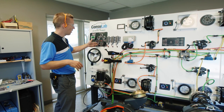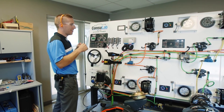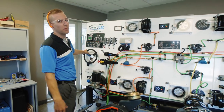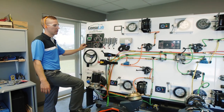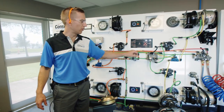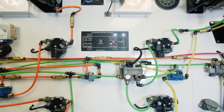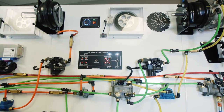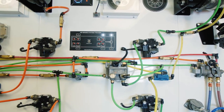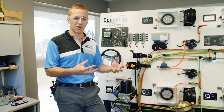We're stopped, everything's fine, the brakes are off. I'm going to put the right rear wheel on ice, and once I accelerate it's going to start applying the brakes to that wheel. Once that's happening I'm going to hit the steady state and it will lock it in, and now we can talk about it with your students over a long period of time. All I did was lock in the steady state — now we can see the hold release solenoids being applied. Now if I remove the steady state, the system returns to normal.